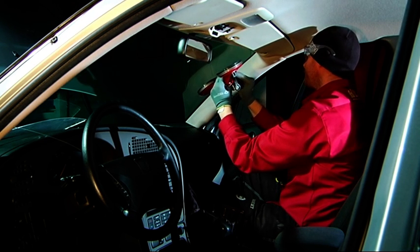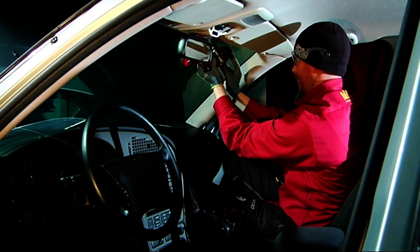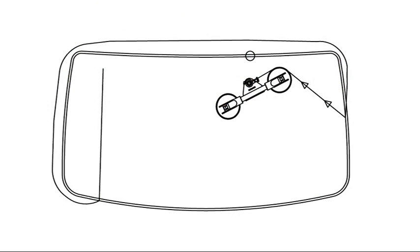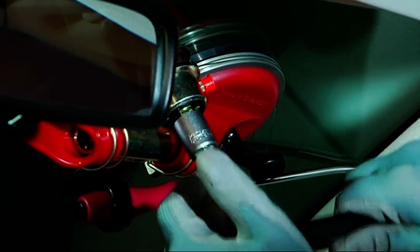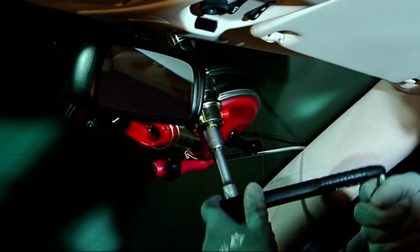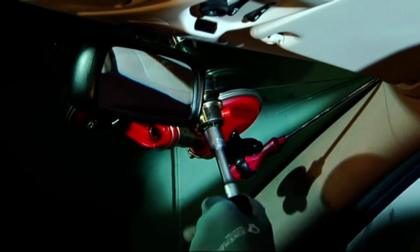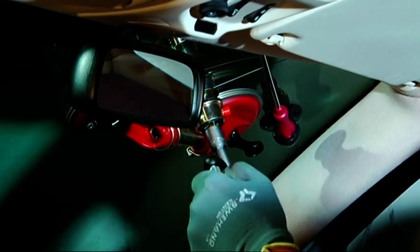Hold the unit with the spool turned against the glass's fold. Release the suction cups. Loosen the wire while moving the unit to its new position, but remember to keep the wire tight. Keep the black locking device out and apply the unit as the picture shows. Remount the extension and ratchet. Press the wire against the glass using the parabola chisel, making sure the wire lies in the guiding slot so that the upward pressure eases the cutting. Cut around the corner until the wire is right-angled with the spool. Leave this unit for now.